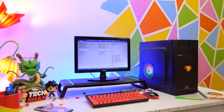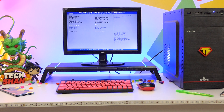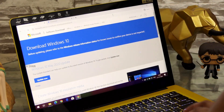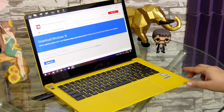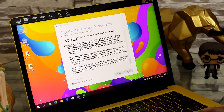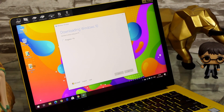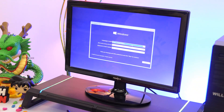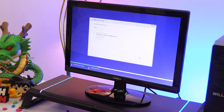Here is the PC setup on my desk. For demo, I am using a 15-inch Frontech monitor. Do note, you get entry level monitors in the offline market for around Rs 2500, so if you don't have a spare monitor you can get it for as low as 2500. Now, many were asking how to install Windows after a build — here it is. First, from a different computer, go to the link on screen. Second, download the installation media creation tool. Third, insert a minimum 8GB pen drive in the USB slot and open the creation tool and follow the on-screen instructions. Make sure to select the pen drive to be changed to bootable. Fourth, wait until Windows gets downloaded to the pen drive and the pen drive is changed to bootable. Fifth, once done, insert the pen drive in the newly built PC, restart and select the pen drive and you can see the Windows installation screen pop up. Follow on-screen instructions and install Windows to the SSD. Do note, you need a Windows 10 license key to activate — you can grab an OEM license from a reliable site for cheap.